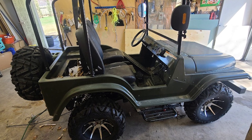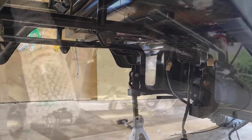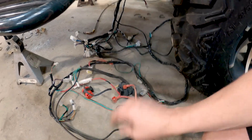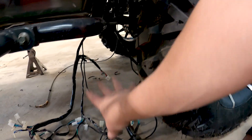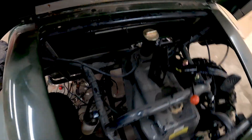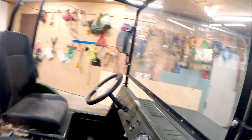The first thing we've got to do is strip out the old running gear. It's all in the back — luckily on a separate frame, so all you've got to do is unbolt it and the whole thing comes out. The first thing I did was unclip all the electrical — I just unplugged everything I could. It all comes back up under the hood. We went under there and unclipped everything, which came through the firewall.